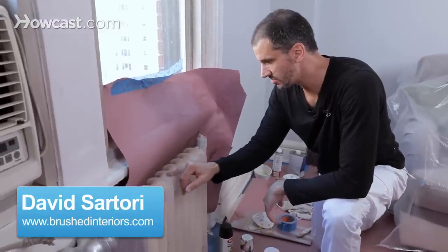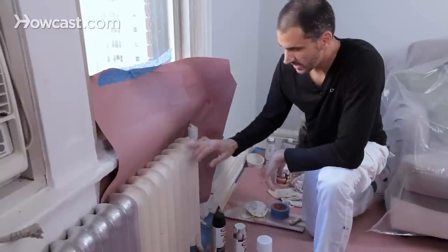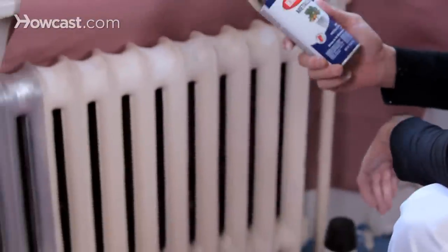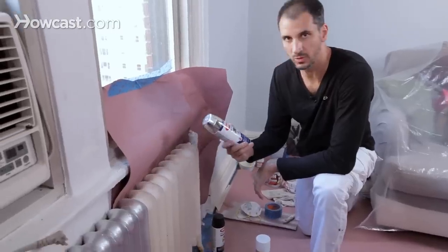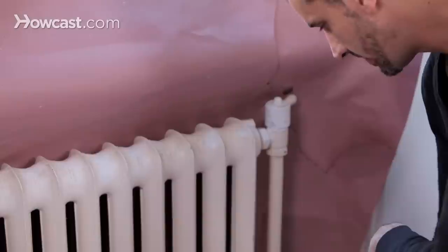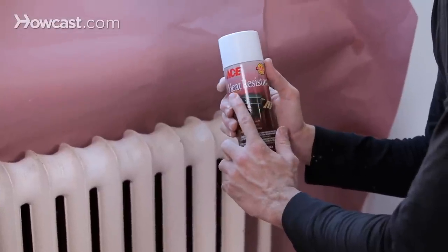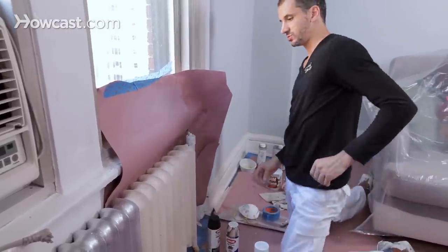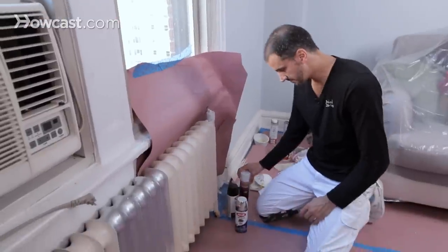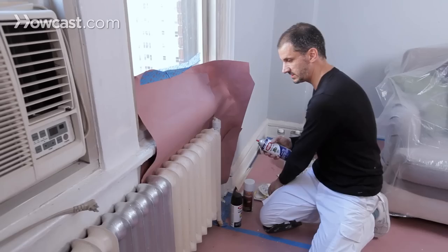The primer is dry and we've wiped down and dusted out the radiator. The best way to paint these is with spray paint — why go through all the trouble of trying to brush it in? Go to the store and get yourself spray paint. All the modern spray paints are enamel; they're not water-based. The old-time high heat paint is being sold less and less — it actually has more volatile compounds and toxins than a regular enamel paint. The guys at the paint store say modern enamel spray paint is just fine for even a heat-sensitive object like this.